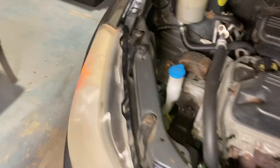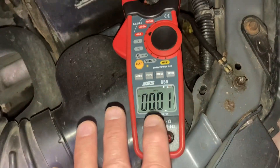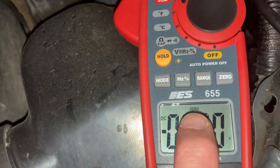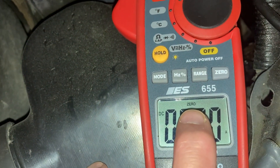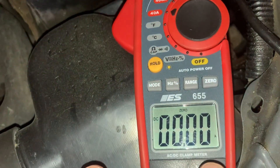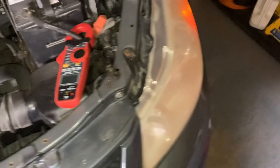Now that draw — although the load is still there from the parking lights — is being nulled out by the meter and ignored. That's why it tells you you're now operating under a relative zero — a relative zero, not zero. Relative zero. Turn just the headlights on, Stevie.